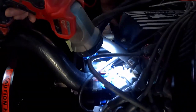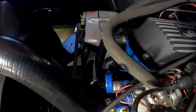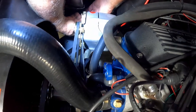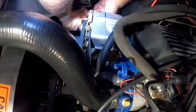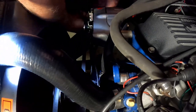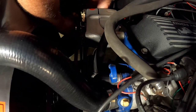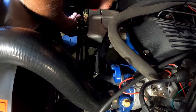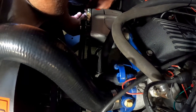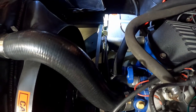Okay. There you go. Right. So, where the belt is on. It's way out here. Yep. So you are putting the adjusting bracket, the bolt through the bracket and into the alternator, and then you'll pull it tight. Yep. To cinch the belt tight and then tighten that adjusting arm. I don't think that's lining up perfect. Doug. Oh, it looks like you should be able to get that in there.